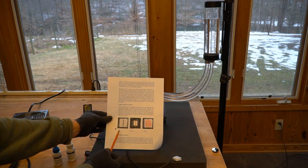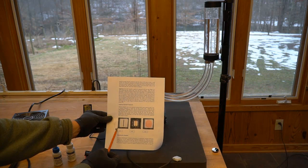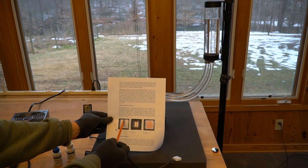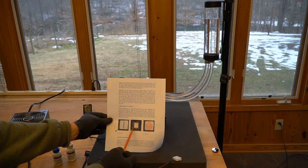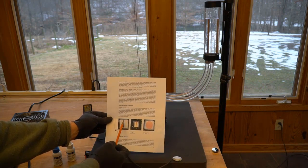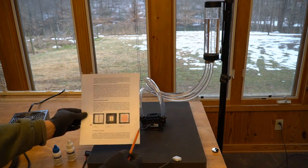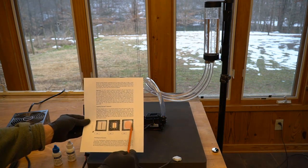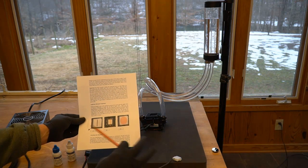Here is an example I downloaded from the Arctic website, which shows the method I actually use. I use a line. Here's the little triangle corner in the bottom of the CPU to give you orientation. Basically, it's from the top of your CPU or the top of your case down, and that follows the die inside. So I make a line about a millimeter, millimeter and a half wide from top to bottom, and when I put on my pump, because my CPU is dead flat, most of it just squeezes out to the side, and you end up with almost just a micro thin film of thermal paste, which is what you want.